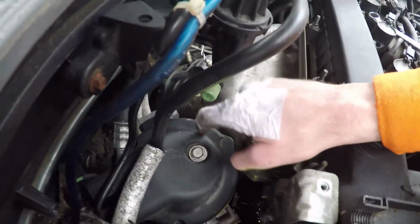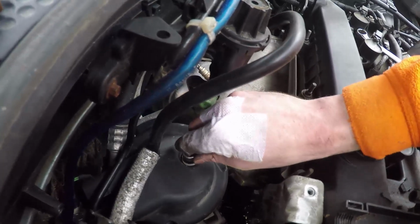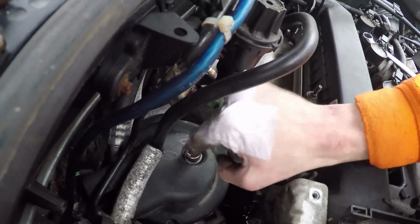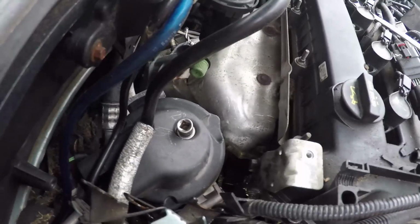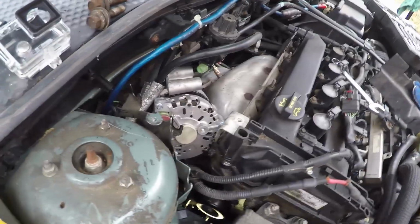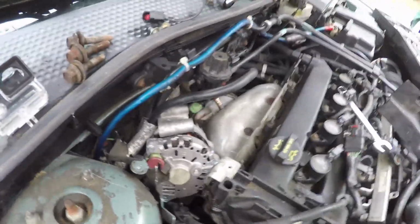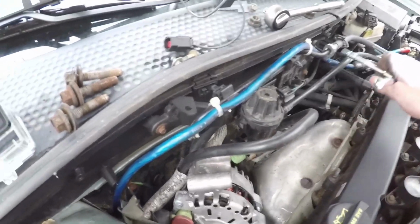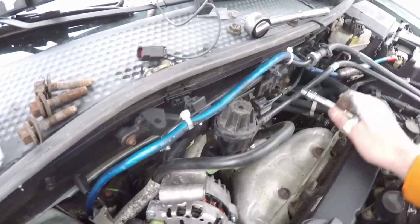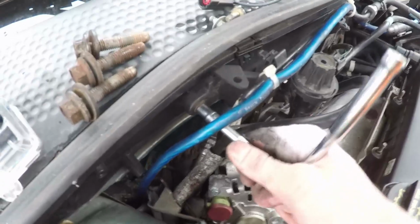Either way, there's this plastic cover still meant for the heat shielding on the other side of the motor. Just a 1/2 inch fits on there, and you want to take out that bolt on the top, where it's sitting on top now. So the last piece to get the alternator out of the top, you can see it's almost right out, is to remove this, it's some sort of vacuum line, and your fuel lines come through here at the top. There's one over here, which is a 9/32, and one over here, which is, of course, another 9/32 there.